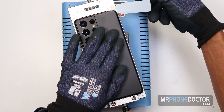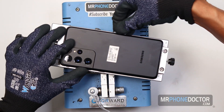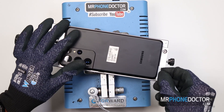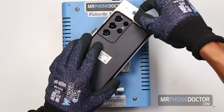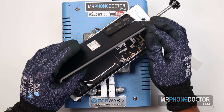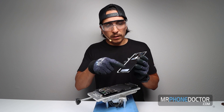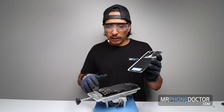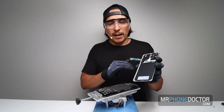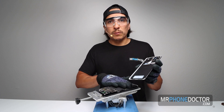So I'm just going to go ahead and slice through. You always want to be mindful never to go in too deep — if you go in too deep, you may actually damage the QI. You want to always just go in; it's really a feeling game. I can feel the adhesive just slice right off. The good thing is all this OEM adhesive is still good — it's nice and tacky. I like to leave it on and add another layer when I reapply it. Sometimes this gets all corroded and torn up and you can't do that because it'll cause gaps, but if it looks good like this, we can go ahead and lay another layer of glue on it and stick it back down.